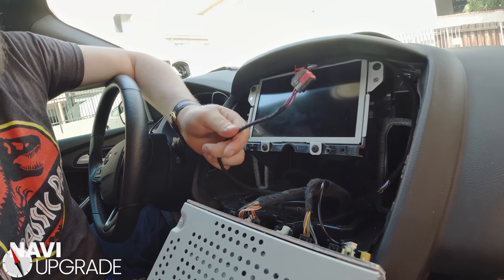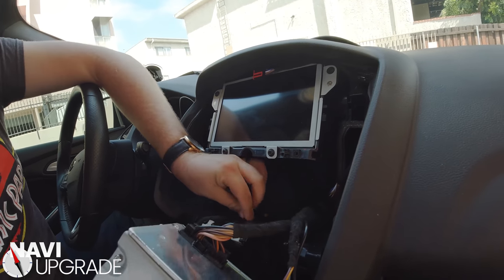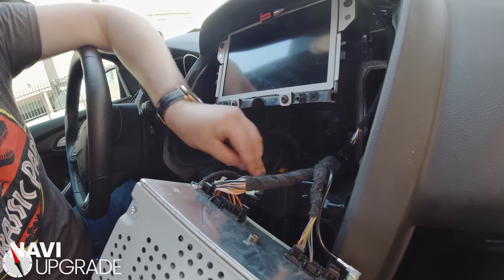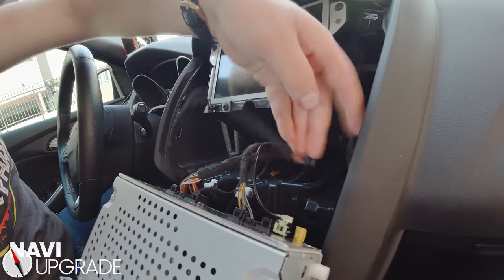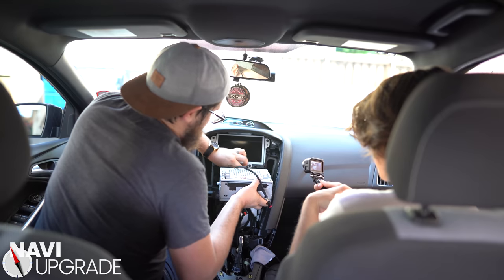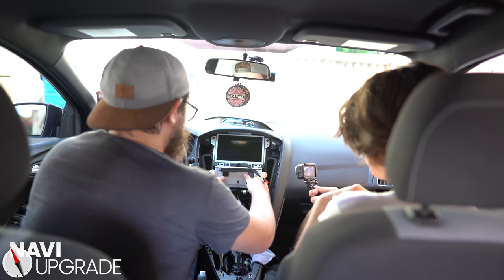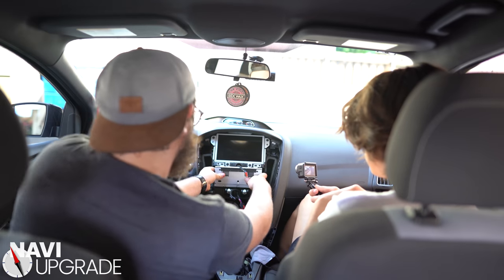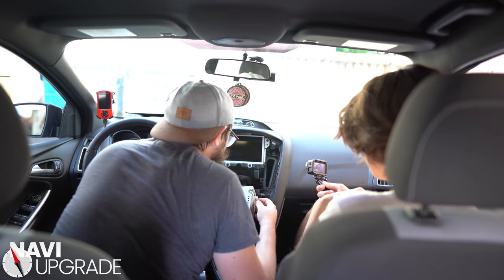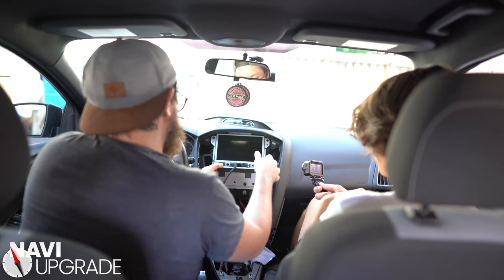As you can see, this is your new SYNC 3 controller connector. We're going to place this right where the old one was, down in here, right where your airbag light connector is — so that's in there. Remember this hazard switch connector — it needs to run over on top of your ACM just like this. As you push it back, always double check your wire clearances and push it back again. We're mounted up.